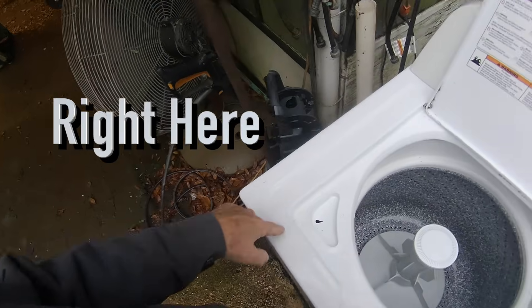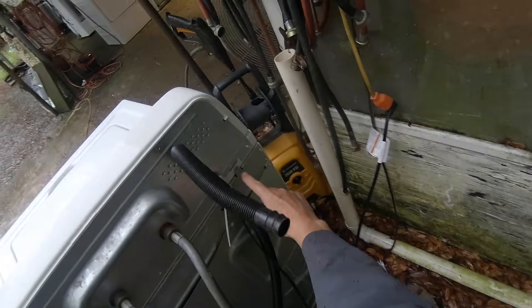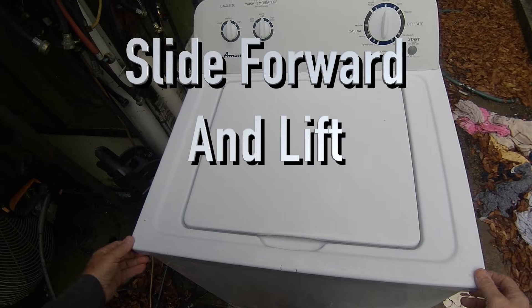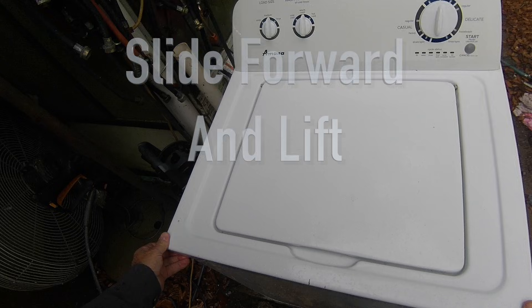It's a bit difficult to retrieve because it's probably sealed inside a plastic bag that's glued firmly to the cabinet. But there's an easy way to get to it if you have this type of washer. First, go behind it and remove the two screws from the back of the machine, and you can also remove the wiring harness and pressure hose cover. Now slide the top forward about two inches and while lifting at the front edge of it, wiggle until it comes free of the hooked tabs that keep it secure on the front.